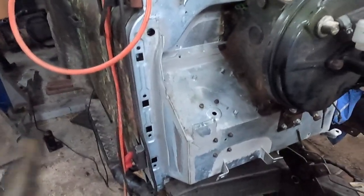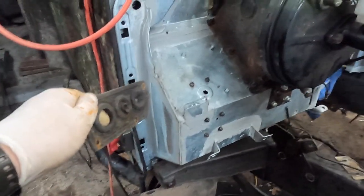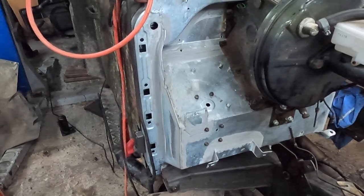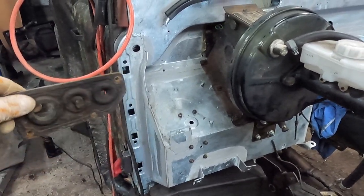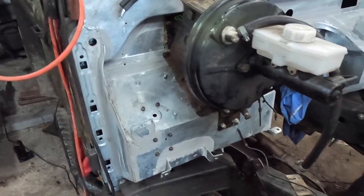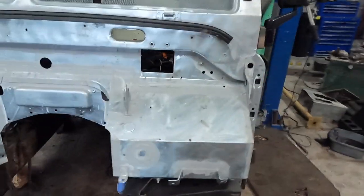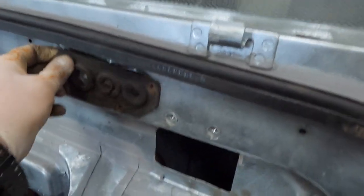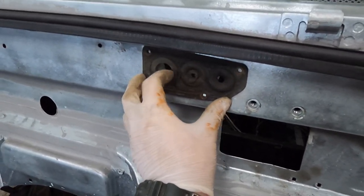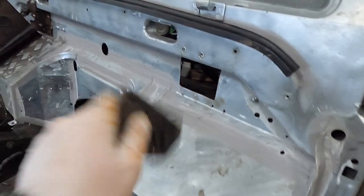A couple of little bits just before I forget — there are actually four bolts up here holding your wings on. The first two are easy to get to, the third one's a bit of a pig, and the fourth one is special, that's all I can say. When we took the old wing off we ended up prying the wing out slightly and just zipping it with the grinder, because for the amount of time it would have taken it just wasn't worth it when we're replacing with new. So just bear that in mind. Next step — before we put the heater box on, I'm just going to put this full gasket back in, tidy it up, drill four holes and tap it on again. This is just to stop water flying through during river crossings.